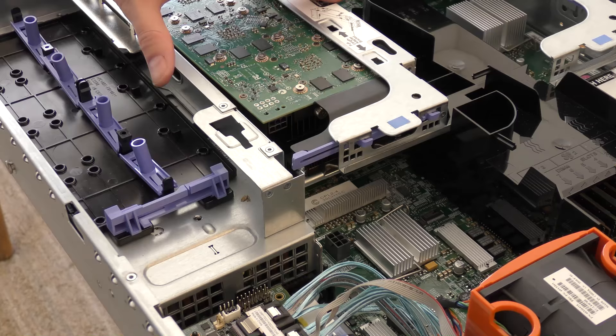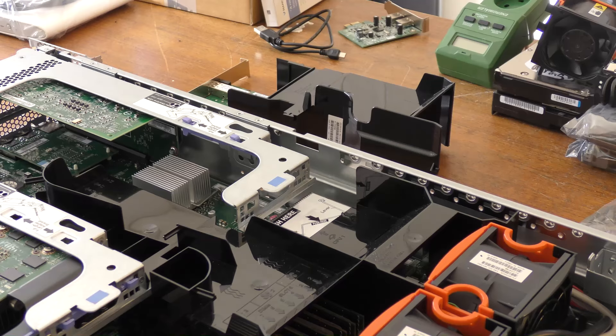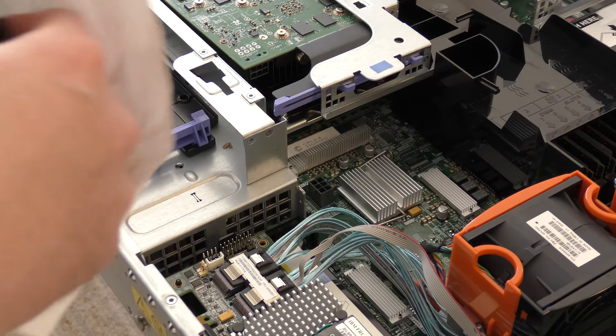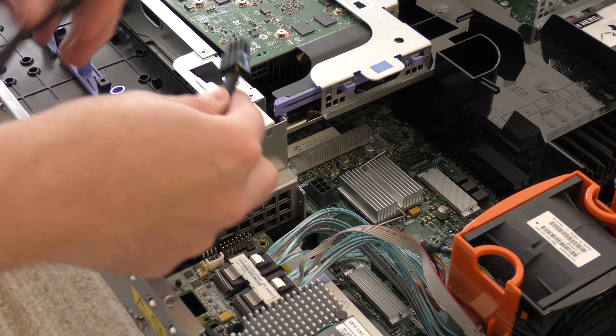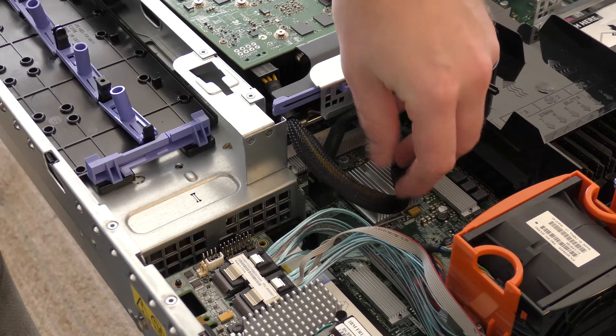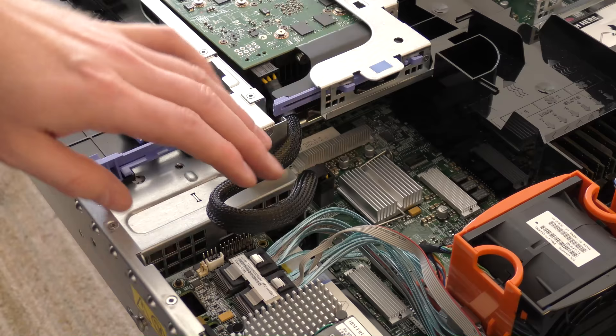Last time I put a graphics card in this server I had a lot of trouble getting power from the connector across to the other side. That slot over there was the only one where I could fit it before because of a big heat sink. This card is more manageable, and I bought the right cables for this — they go directly into the graphics card. With a little twist it goes down to the motherboard system board. Just need to tuck that extra cable somewhere it doesn't hinder the airflow — that's kind of awesome.